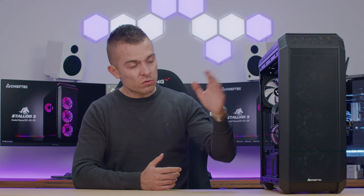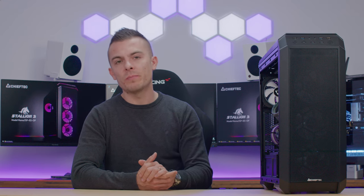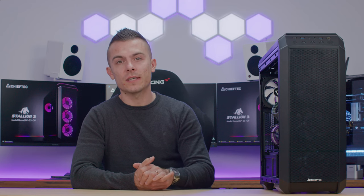Yeah. So 360 on front, 240 on top with slight modifications, but it's all up to you. You could maybe squeeze a 280, but you do need to take into consideration carefully the calculations and everything. Do check before cutting the case.